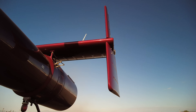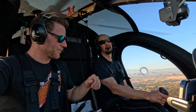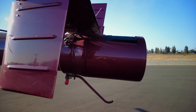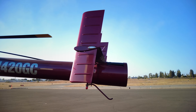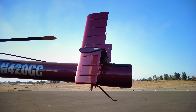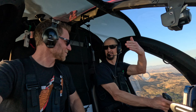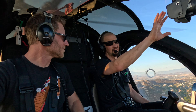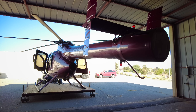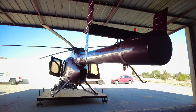It's also got those giant vertical stabilizers. I really like those things when you're at speed — above 70, 80 knots they're very, very effective. They just keep the ship really, really straight, even in heavy winds, making it very stable. In a hover you're not going to have as much tail authority in high elevations — that's the only time I've ever noticed it. There's nothing you can't overcome. If you're in a 30-knot crosswind trying to land, why would you be against the wind? I did that once in Santa Barbara where I had to detour a little while it hovered, but once you get straight on takeoff it's fine. It takes some time getting used to, but once you're used to this thing the controls — there's nothing to complain about.